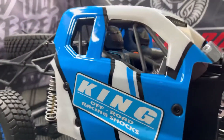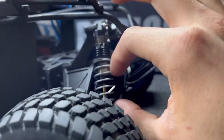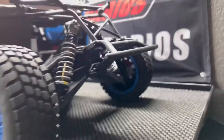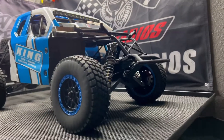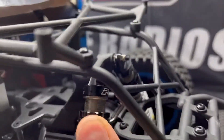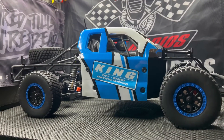When I purchased all the shocks, the rear shocks actually came with a spare secondary spring as well as a primary spring. While I was tuning the shocks, I decided to put that rear secondary spring — which is a stiffer one — on the front, just cause I wanted it to be a little more stiff. I also tightened up the collars a little bit, so it should be good now. And that's pretty much it for the front — 35-weight oil.